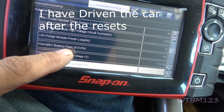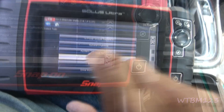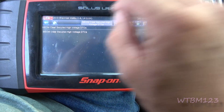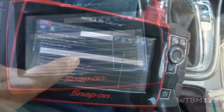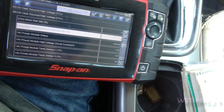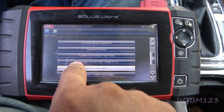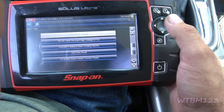If you look here, the state of battery pack charge is 47%. It was 5% when we started. Now also, you see it says BECM clear secure high voltage DTCs — I went into there and cleared those as well. It tells you the drive motor belt slip percentage and the drive motor belt maximum detected slip. If you notice, both of those are zero, so that's telling me the belt for the drive motor should not be slipping.